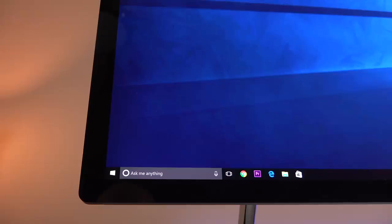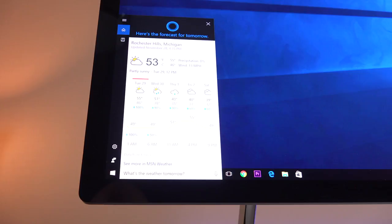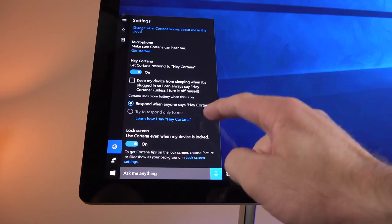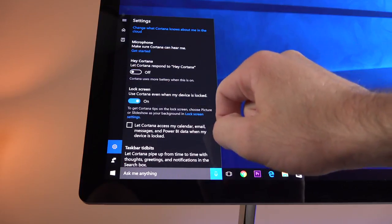If you look at the top center of the display, you'll see quite a bit going on, including two cameras. One of them is a Windows Hello camera — basically the face-scanning camera that allows you to unlock the computer using your face, and it works pretty reliably. There's also a set of infrared LEDs that light up your face for that feature. There's also a 5-megapixel 1080p front-facing camera which delivers fantastic quality — definitely better than the FaceTime HD camera on the iMac. We also get a set of dual microphones designed to work with the Cortana feature, so you can command your computer from across the room. This feature is turned off by default, you'll have to turn it on under Cortana settings, and you can train it to your voice so not everybody can access it. Unfortunately, it only works if the computer is awake, not when it's sleeping.